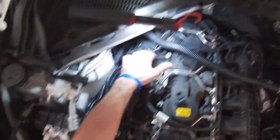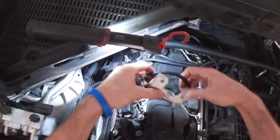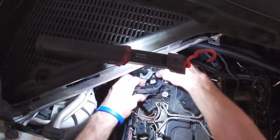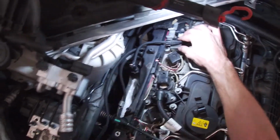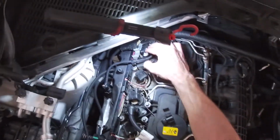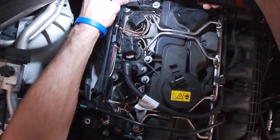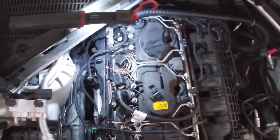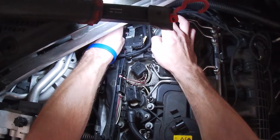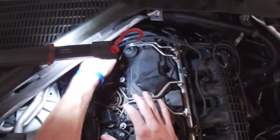So now we have all of our coils installed, we can go ahead and start reassembling the vehicle. First thing is going to be to reinstall that bracket with the wastegate solenoid connector on it. Seat the connector. Grab your T25 screw and then just kind of hold it up so you can see it visually line up with the hole. And then you can reinstall your oxygen sensor connectors. Just make sure everything's in place. Definitely don't want to do something twice.